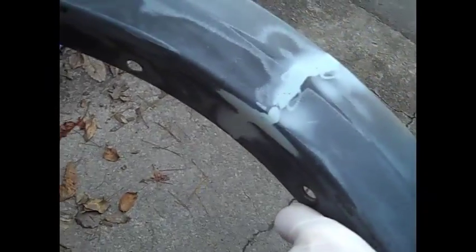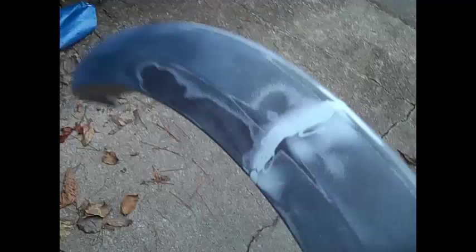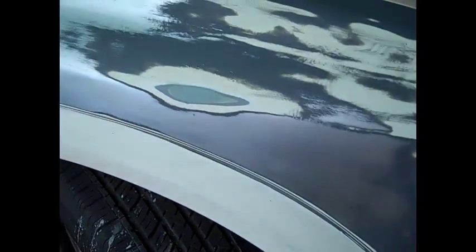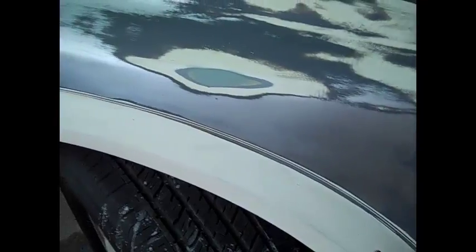I went ahead and filled it, fixed the groove I cut into it, and got rid of the crack. While I was at it, since I already had it off, I went ahead and fiberglassed the crack from behind to give it some strength. Like I said, I'd just replace it if it was a top-dollar job. I've semi-masked it off — all I'm going to do is spray some primer and not go too hard at it. I put a little filler in that dent, already prepped it down, wiped it, and it's ready to prime.